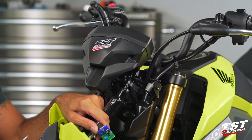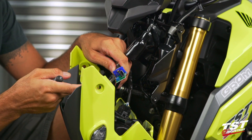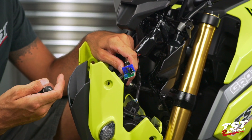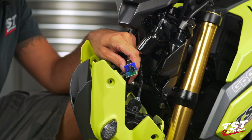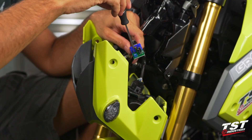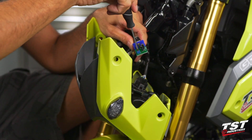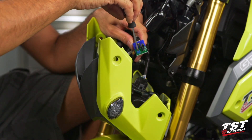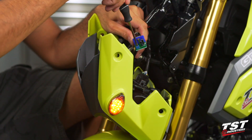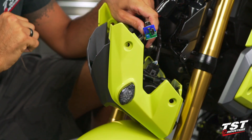This is a straightforward procedure requiring a mini Phillips screwdriver. One thing to note: you're holding a naked circuit board with a lot of contacts on it — please make sure you do not touch it to any conducting part, as you can ground it out and blow a fuse or damage something on the board. Power up the bike and activate a signal you can see as you adjust. Turning the center of the potentiometer clockwise will slow down the flash rate, and going counterclockwise will speed it up. On this particular bike in this configuration it's a slight change, but it still allows fine-tuning.